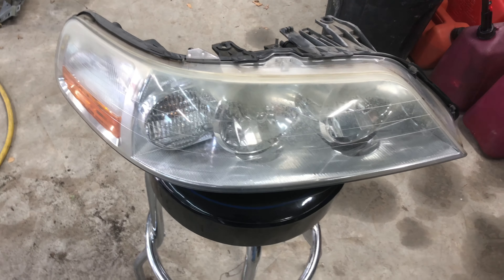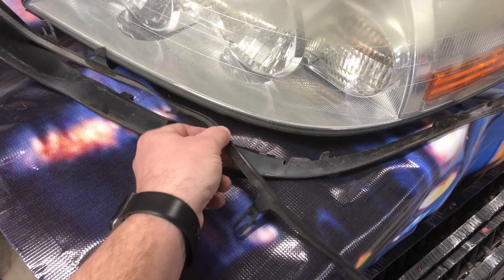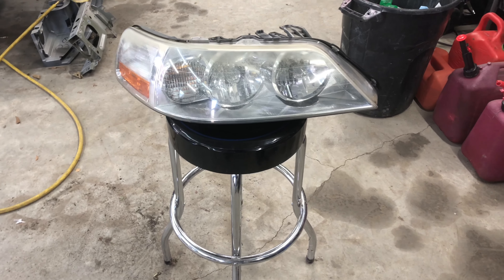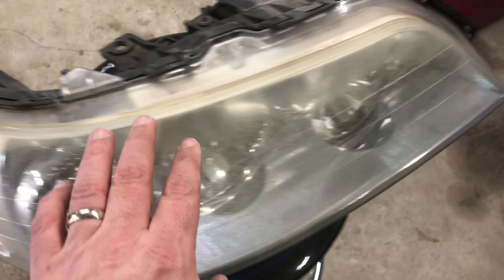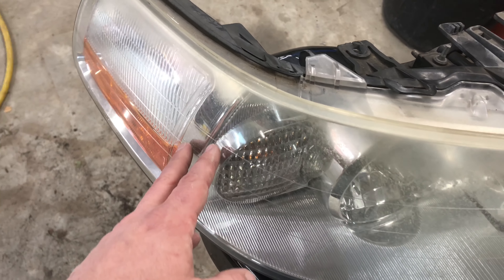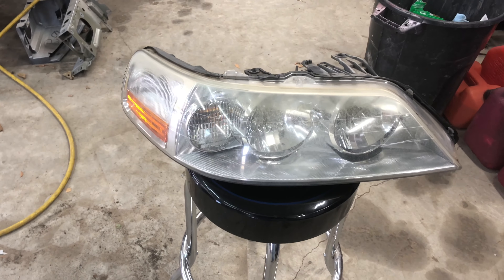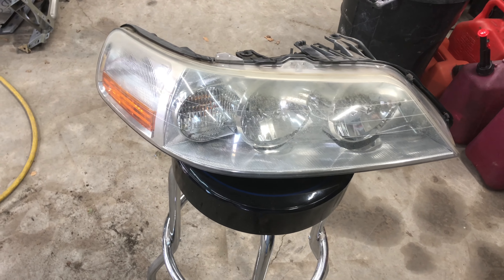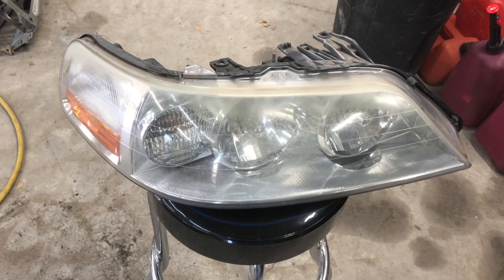In the meantime I'll start working on these headlights. What I've done is taken off the molding that goes around the outside — if you look at this headlight there's a black molding that just kind of pops off, and the bottom one's double-sided taped on, just like a rubber seal. I've got my DA sander loaded up with 400 grit sandpaper and I'm hoping to get some of these little cracks and pitting out. If I can get that pitting out, hopefully these headlights will come back. I've learned my lesson — if you watched the video where I polished the headlights on the Marauder using that Duplicolor clear, I will not be using that on this. I'm actually going to use a 2K automotive clear that I'll have to mix up and spray through my spray gun, so I'm not going to use any cheap clear.